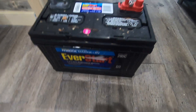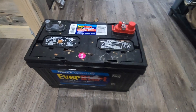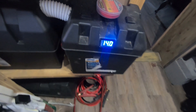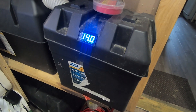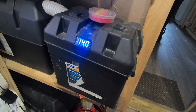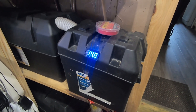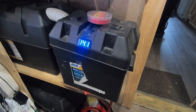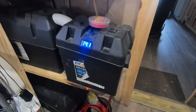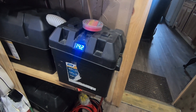You're probably wondering why you're looking at a battery. I got two of these at Walmart and I'm going to be replacing a seven-year-old RV battery. Right now it's showing 14 volts but at night it goes down to 10.5. Looking at a charging chart, 10.5 means zero charge, and going down to 10 and not staying at 12 means I've got a bad cell. I can't complain — it's an Interstate battery, I've been using it for seven years, it died once, I ran it dry once and brought it back with a BLS battery saver.